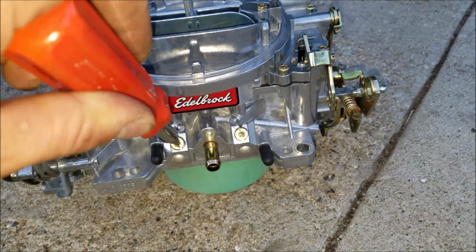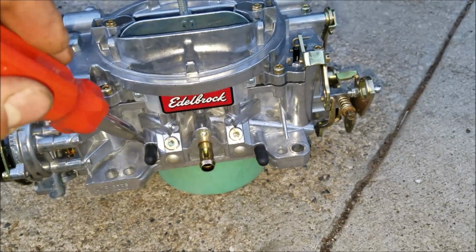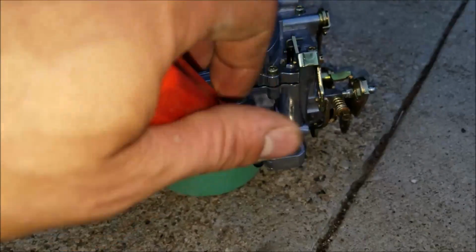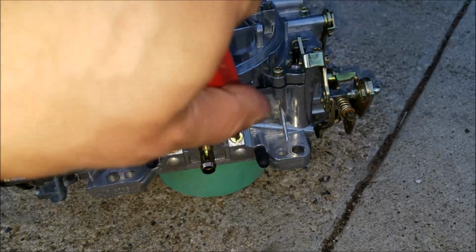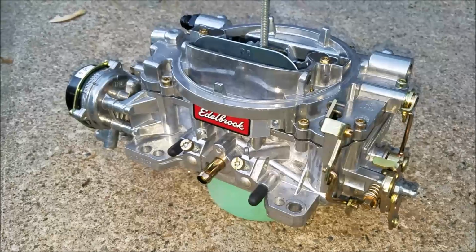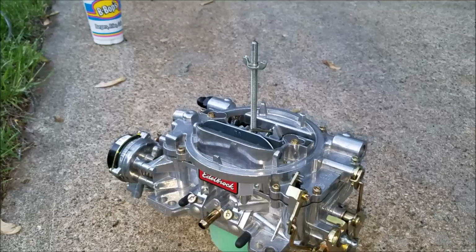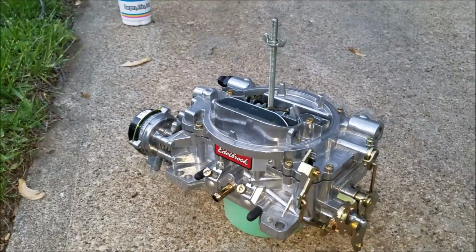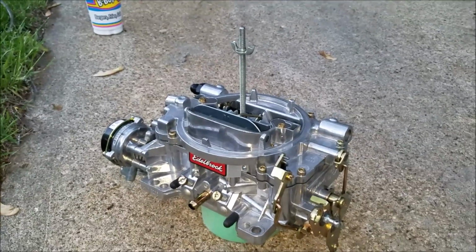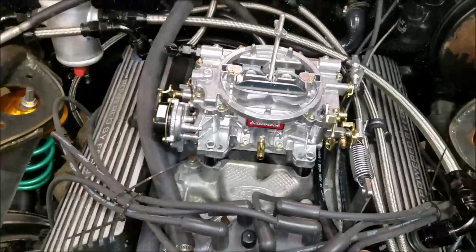Again, you want to take these down until they're seated, but you don't want to really torque on it. The body of the carburetor is just aluminum, so you can do some damage to that. So you just want to go nice and easy until they're seated, and then you can turn them back out evenly. All right, the mix screws are both turned 2 turns out. So with the float bowl setting, when we get that done and the float height set, we'll be ready to slap our carburetor back on, fire it up, and do our baseline tuning. For the most part.